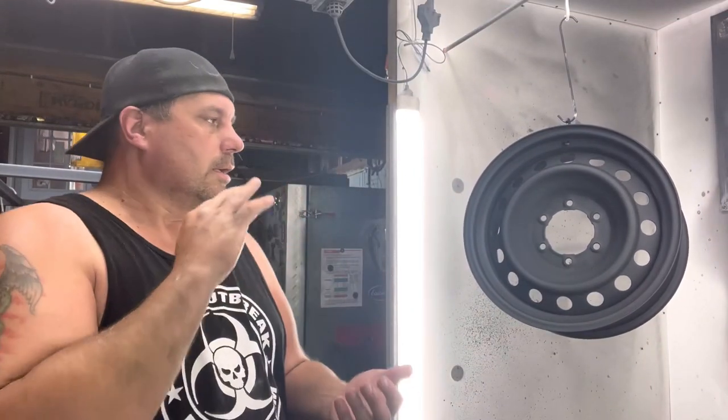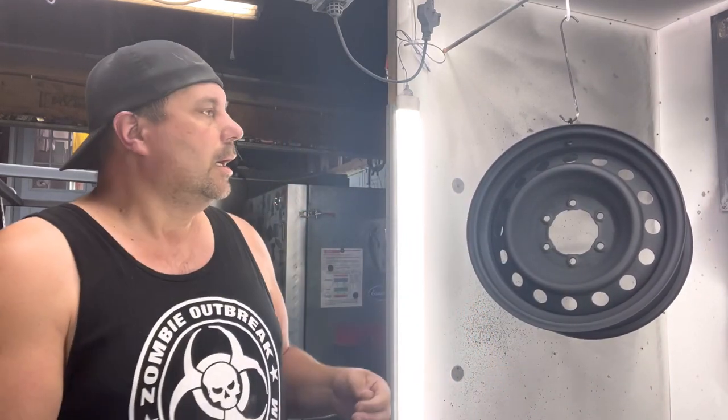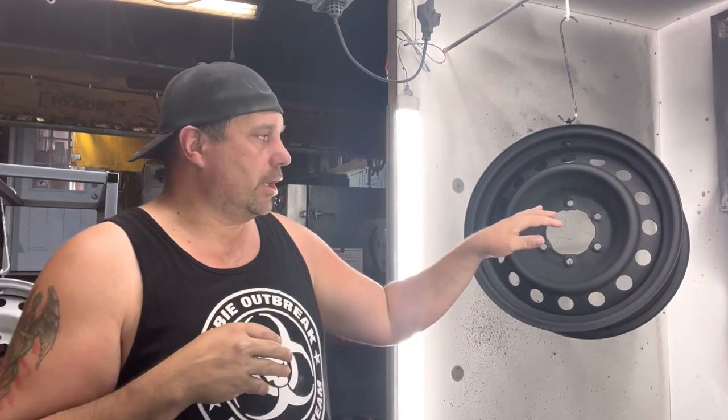Hey guys. So we were talking about earlier, when you get close, you'll hear that crackling. That crackling is basically your KV is probably up too high, or your microamps is up too high. It's gonna be back ionization. I'll put a video I just did on back ionization with KV and microamps up here somewhere. So when that happens on your coat, it'll create this thing that we call fish eyes, spider webs, whatever. It really shows when you do your clear coat. When you do your clear coat in your white, you'll see the spiders or the fish eyes.